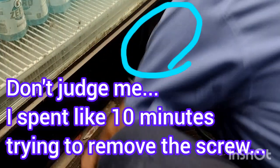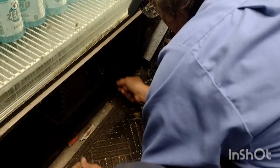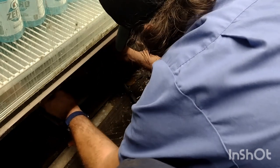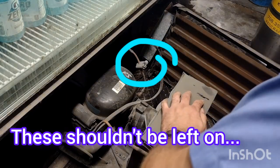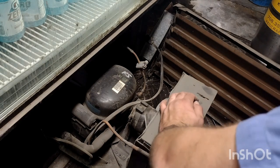The first thing we're going to do is pull it out and unplug it. You'll notice that I cannot pull the grill off and it's already heavily damaged — those screws weren't even screwed into that condenser plate. So I'm pulling it out here and it's been worked on a few times. You can see there's a bullet valve on that compressor stem and it's pretty dusty, so I'm going to clean off that condenser coil — I do that on every single call, even if there's not that much on there.